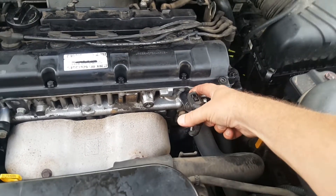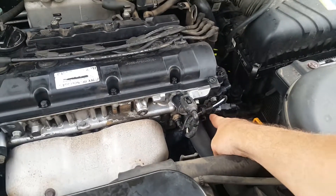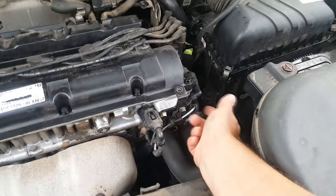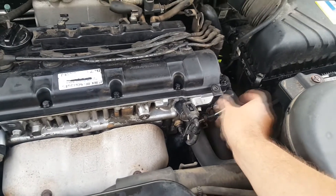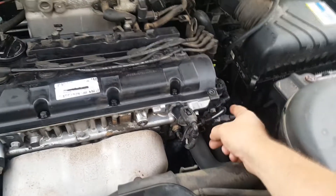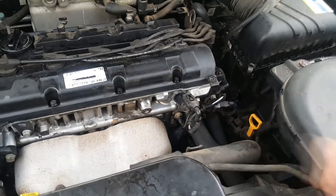I'm not going to replace it today. What I'm going to do is take it out and give it a good clean. I'm mostly going to take the filter out from underneath there — I'll show you when I get to that. It's a 14mm socket that will take that out. I'll clean the filter and give this valve a clean and show you how I go about doing it.